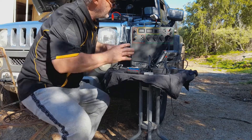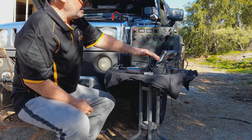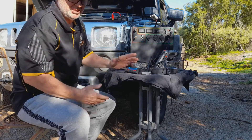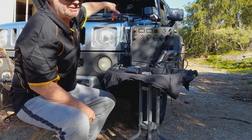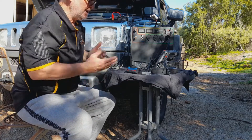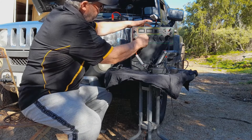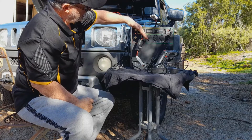The way I've got this set up is I have a 600 watt inverter and I've got the AC-DC charger plugged in and it's showing me it's putting out 12.6 volt from the charger. So the inverter is taking its 12 volt from the battery, turning it into 240, and I'm plugging my AC-DC charger that I'd normally plug into the house. To make sure it's charging, I'm going to plug it in. The red light's on — it's charging.